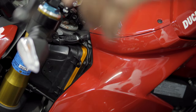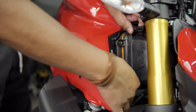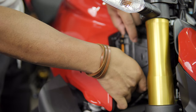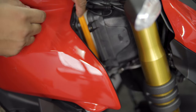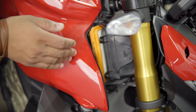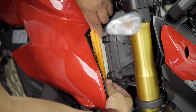We're going to go to the opposite side — it's going to be easier to pull it from there. Turn the steering column. So now we're on the opposite side. I feel like it's going to be a little bit easier to get to. I'm going to shimmy that forward, just the box. From this point, you should be able to see the air filter. The trick is to kind of put the steering column somewhat centered, push on one side, and then you'll be able to get a better grip to shimmy the rest of it out. It is really tight getting through here.